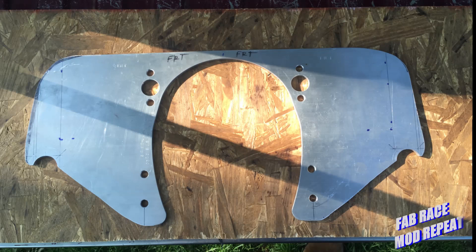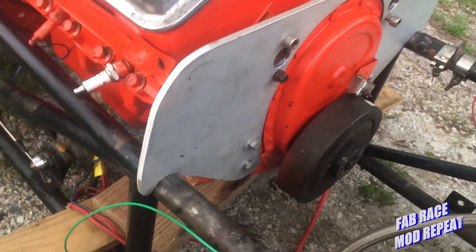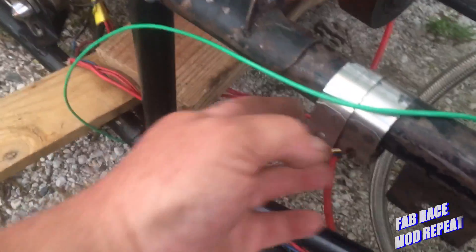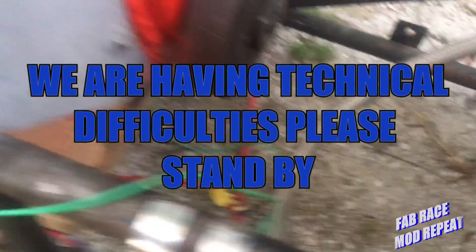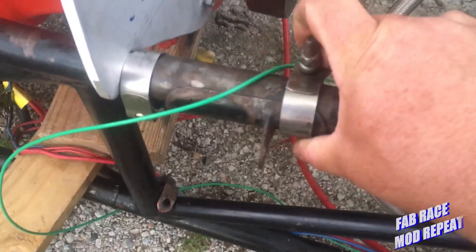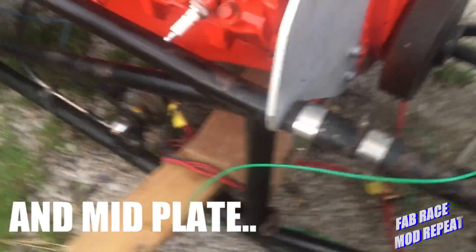As you can see in the picture, there's a little extra material left on the insides of the rail mounts so I can trim to fit if needed. When we did the initial test fit in the car, I did have to take a little bit off the right side. So there it is, mostly installed temporarily. For those wondering how these attach: you get a little saddle rig that goes on top, slides back under the engine, and the bolt goes in there. These little T-straps hold this to the frame, and you just tighten them up. That lets you slide the motor around so you can run a big block, small block, Ford, Chevy — whatever you want in the rail. You just change the transmission accordingly and get the right motor plate.